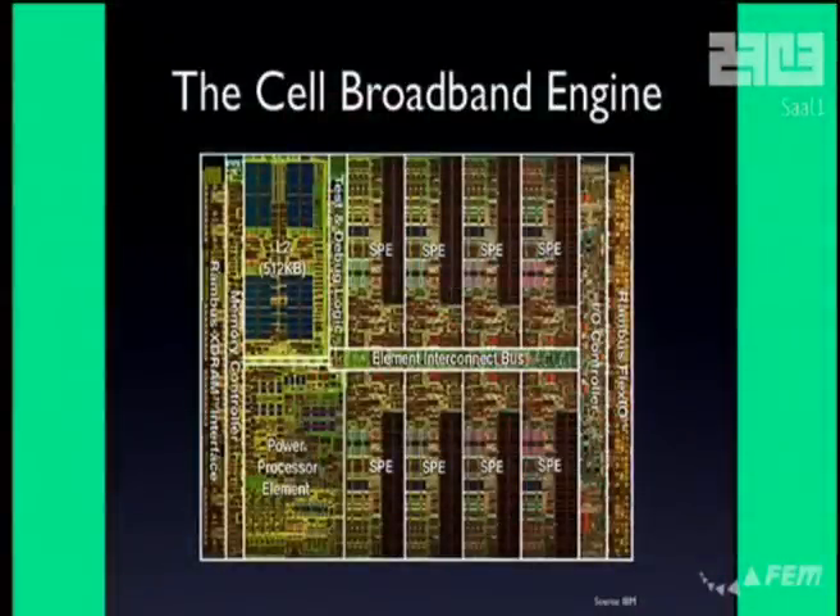Before we talk about how we can break the security system, we have to talk about how the PS3 actually works. What Sony did was ask IBM for their Cell processor, the Cell Broadband Engine. It's essentially a 64-bit PowerPC core, and they have eight SPEs or SPUs — Synergistic Processing Elements — which is just a fancy name for vector processors. Each of those has about 256 kilobytes of local memory, and that memory cannot access the rest of system memory — data can only be DMA'd in and out of it.